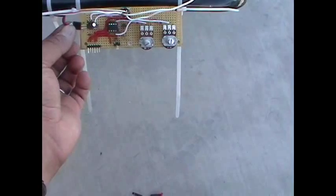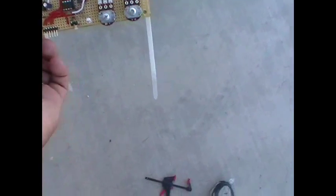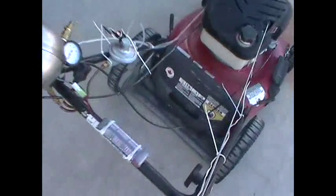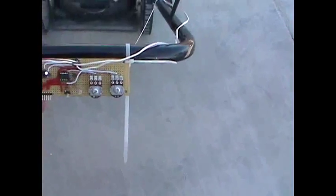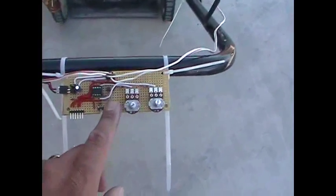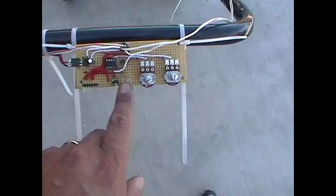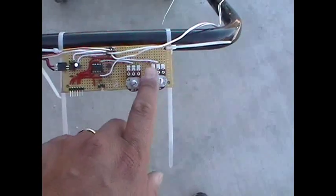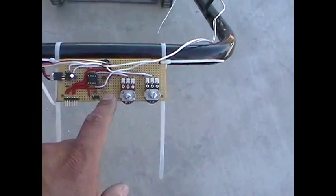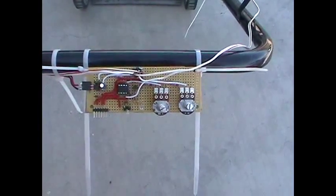Let me give it a little power here. All right, I have a little LED here and you can hear the solenoid firing. The engine runs at about 50 hertz. What you want to do is adjust these potentiometers so that this light is basically steady state — a little flicker is okay. Initially you'll see that it flickers quite a bit, and then it settles down as you adjust them. I guessed pretty good on these initial settings, and now I can go back in and actually hard-code a starting preset. But I really don't seem to need to, and I'm not going to right now anyway.